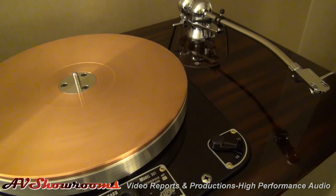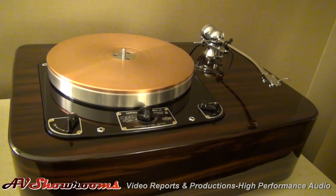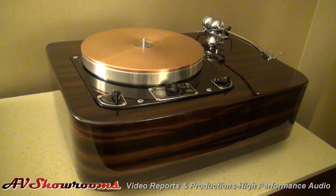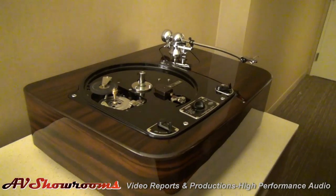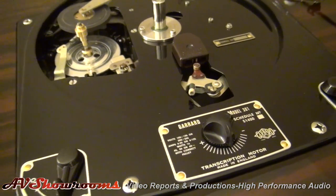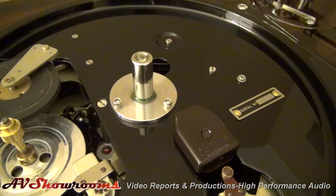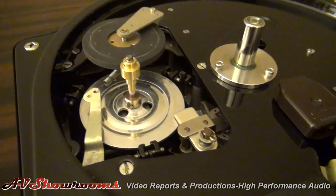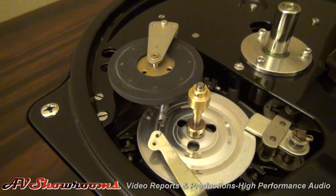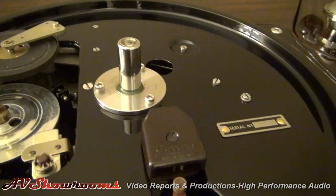It's one of the most beautiful turntables I've ever laid my eyes upon. Thank you very much. If you'd like to take a peek underneath the platter, we can accommodate that request. Let's lift the lid. Oh my gosh — that is not your grandfather's 301. Completely new bearing, completely new platter, new precision idler wheel. And precision CNC machined motor spindle made out of solid marine brass. Simply outstanding.